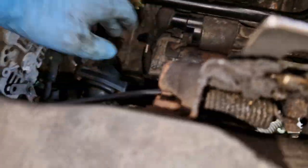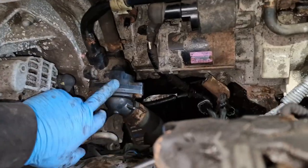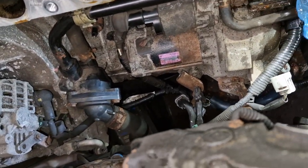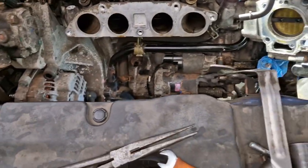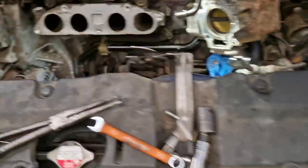Obviously, you get these two coolant pipes, and the spider in there, thermostat thing there. So we just had to take the whole manifold off it. There was just absolutely no way. And to get the manifold out of the car, I've got the engine jacked up and shoved back as well. So I'm going to need to take the starter out of it, put the engine mounting back down, then put the car back up, support the engine, and take the gearbox mount off.